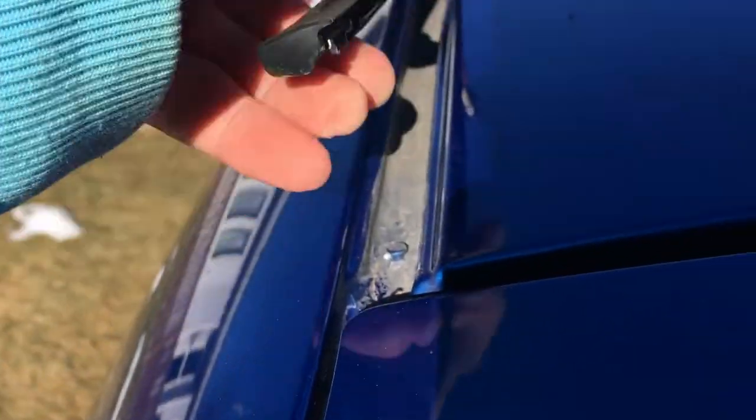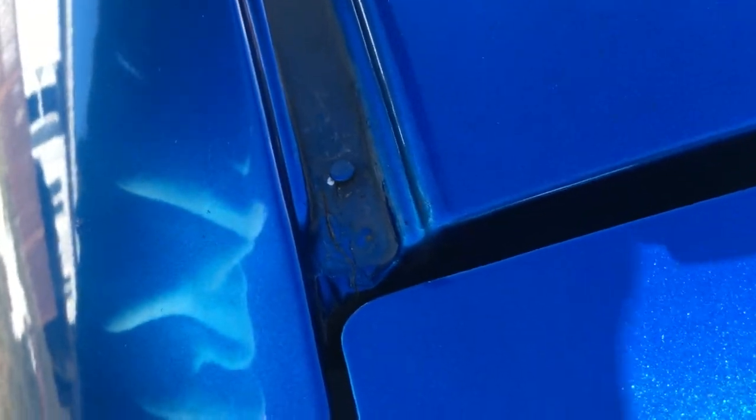I've identified a crack at the beginning of each channel on the sides of my roof. I'll be showing you how to remove these trim pieces, which is as simple as popping the clips on each end and pushing them forward. You don't need to take these all the way off — the cracks generally end a few inches from the beginning of the channel.